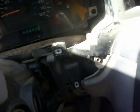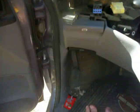There's two screws here, two screws over here, two screws down here, and two screws on the bottom to pull this cover off. You can't pull it all the way off without pulling that brake lever off, which I'm not willing to do. So just kind of let this lay down, hang over, and the rest of it's all just clips.